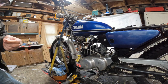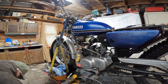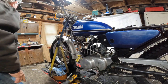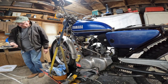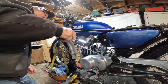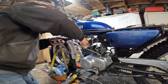The head gasket is not blown. I actually don't know if I've ever had the head off of this. I kind of need to look in there and see if the cylinder is scored. Let me see if I can feel anything. Yep — I can feel it. There's a groove.